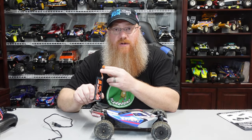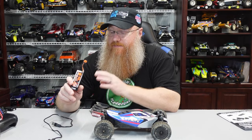So I hooked it up to the X2 Pro charger. Wouldn't charge it. Kept giving me a fault error. Now I had a little XT20 plug on there, but evidently because it is not jiving with the smart battery, it kept giving me an error. So I was forced to sit around with this, and it sat there for a little over an hour, I guess, charging on that. And I was like, screw it, it's good enough, I'm ready to go. You know, my GoPro battery's charged quicker than this did. That's my only gripe about the car.